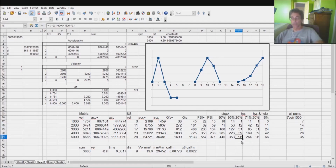That means you're pushing oil out of the system rather than into the system, which means that during this particular time, which happens twice, now this is going over the nose, but this is only half a cycle. This represents only half of what's going on. You'll see this one twice. Now, in one of the earlier videos, I told you that this particular piece is about 25% of the time, and being that this is half of what's going on, that means this other half must also be about 25% of the total time. Since for 25% of the total time it's not putting oil into the head, and it's impossible to put oil into the head, we know that certain things that were going on inside the system were beyond Hoover's capabilities. So let's go back and take a look at what he says.